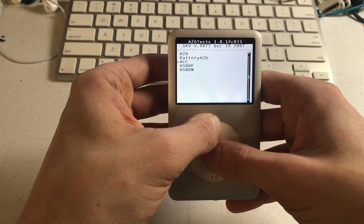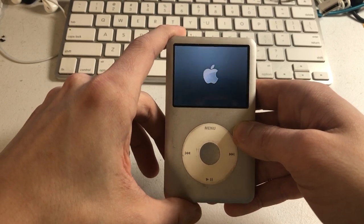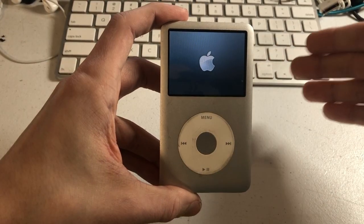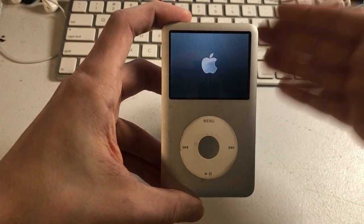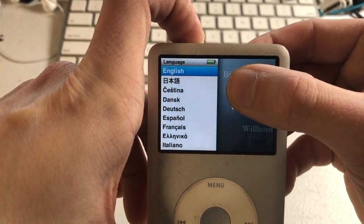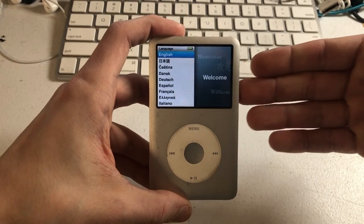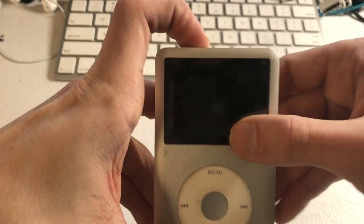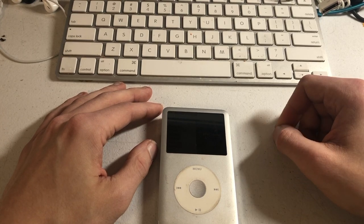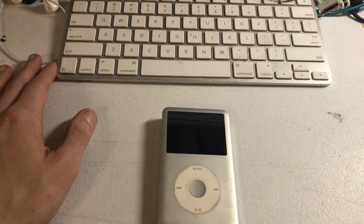When I restart it, it's probably not going to show fully charged — they are old batteries, old technology. They have a hard time telling if they're at 100% or at 90, 95%. The best way to tell is by doing that A2D test. We could call that 85–90%, which would line up with 4.2V at 100%. So at 90%, operating at 4.08–4.1 volts — that's all good. It's brand new, it should be. That's the baseline. So let's move on to a used battery.